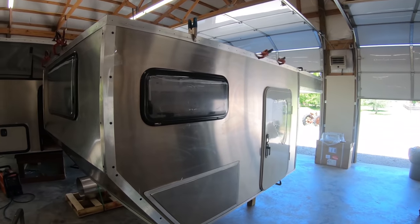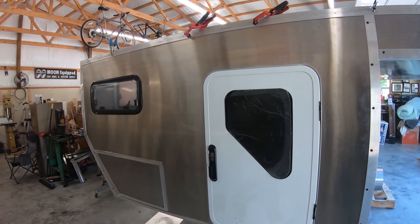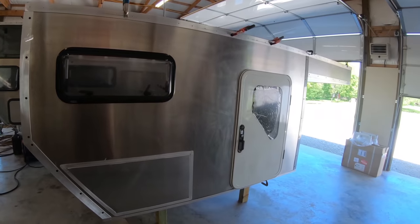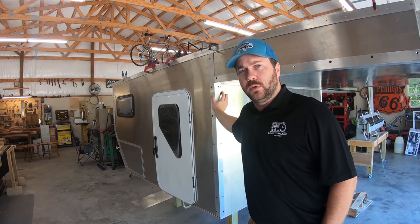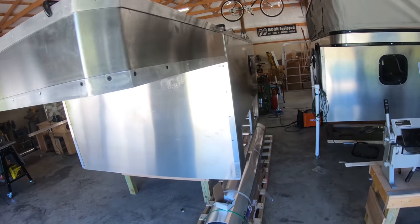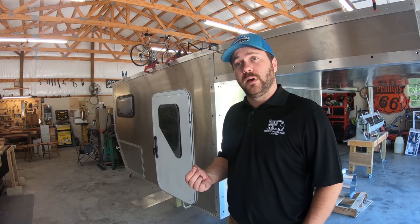I've had some Four Wheel Campers and a bunch of different campers in the past, and there's a hole in the market for flatbed shell options. I would have loved a Four Wheel Camper flatbed shell, but the cost was the issue — I wanted something under twenty thousand for a flatbed model. We figured we could build our own using better materials. The frame is about 80% one-by-two 5052 aluminum, eighth-inch wall, with some one-by-one mixed in. The skin is 5052 aluminum sixteenth-inch — about point-zero-six-two-five — roughly double the thickness of the comparable Four Wheel Camper.